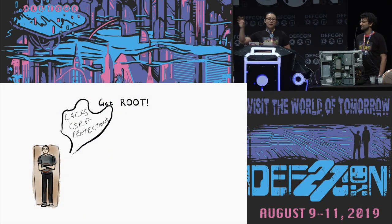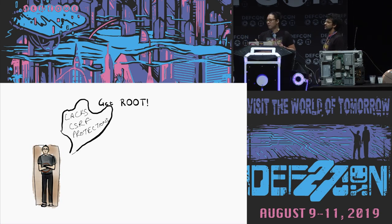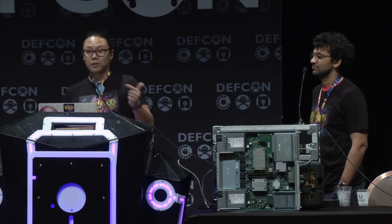So if you couple any kind of code injection on any part of the attack surface of any Cisco IOS platform or device that's affected by this, you can immediately use that to escalate privilege and then update the firmware, update the bitstream, and then disable the FPGA, the trust anchor. So you can take a remote exploit, couple it with this, and make a permanent modification of the hardware that is impossible to undo using software.